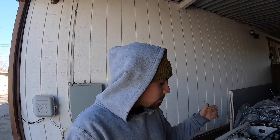So that's where we're at right now with this car. We got it to crank, but we do have one problem — the only time we can get it to crank is if we jump the starter. When we would turn the key there would be no crank, no ticking, nothing. But if I tap the starter wire straight to the battery or straight to the ignition, that's when it'll crank. Still no start, but that could be causing the issue. There's probably an issue somewhere in the wiring.